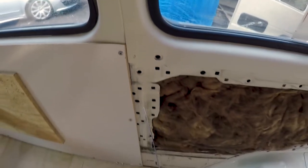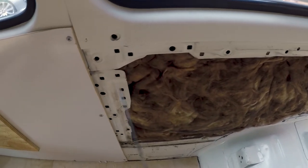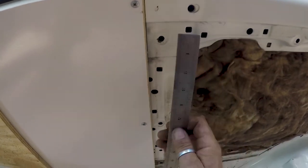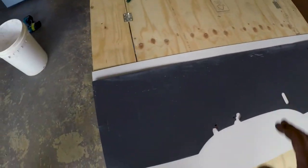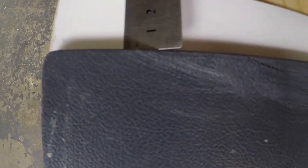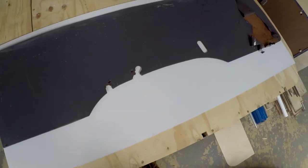Another reason why joining our sheets at the original join here is so that we can use the old panel that was in here as a template for the wheel arch. This is where the old panel would have originally started, so all we've got to do is measure down from the top of our new board down to where that old panel would have started, which is 45mm. Then place the old panel over the new panel, have it flush along the join, and drop it down 45mm. Once you've got it in position flush along there you can mark out the wheel arch on the new piece, then continue those lines down and cut it out.